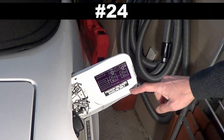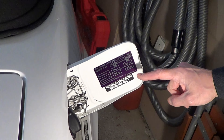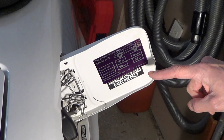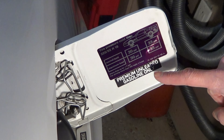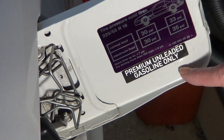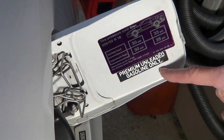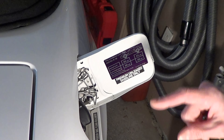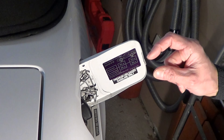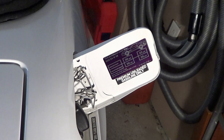Number 24: don't use any less octane than what's written in your operating manual. This usually means you need to use premium gas with at least 91 octane. If you can, search for ethanol-free blends — the less ethanol, the better. Most countries force gasoline stations to include a small percentage of ethanol in their gas, so this may not be something you can completely avoid.